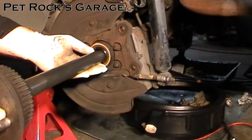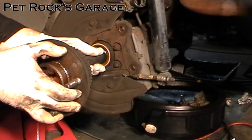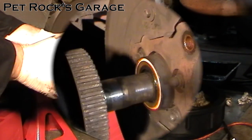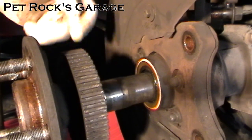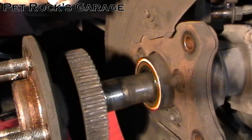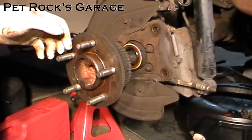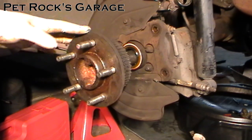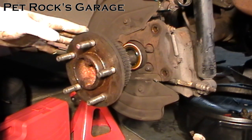Try to keep it nice and straight. Eventually you'll feel it go through onto the other side inside the differential. The other end of the axle with the splines is resting on the hole that it slides into inside the differential case. On some vehicles one axle shaft will actually be longer than the other, so you want to make sure that you keep the one that came out of the right side on the right side, and the one that came out of the left side on the left side.